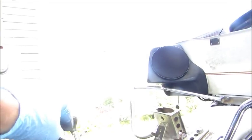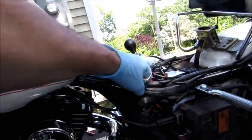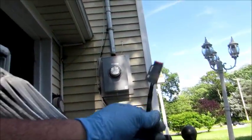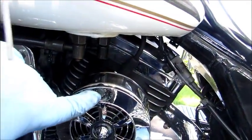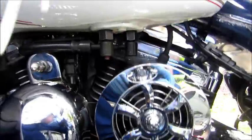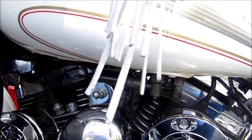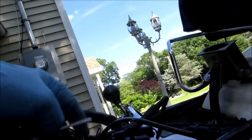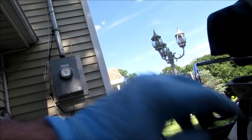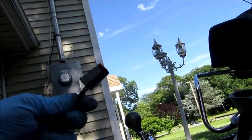I ran the wires up onto my gas tank, through my frame, and to here. This gets plugged into an auxiliary outlet — I'm going to have to splice these wires and connect it to the battery. I put on an on/off switch. These switches here light up. If you can see inside right here, these are two lights but they're actually switches, so I could just shut them off when I shut my bike off.